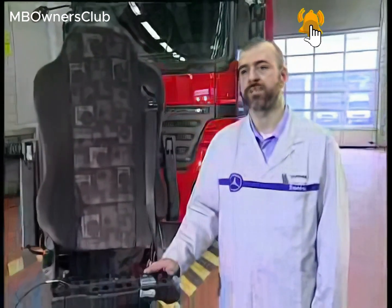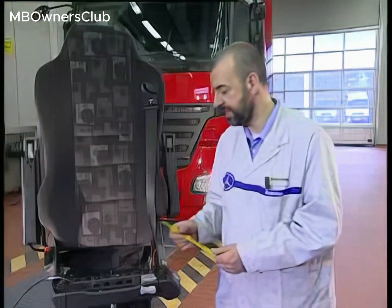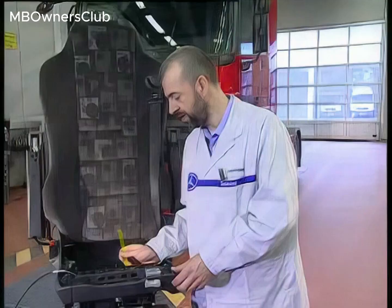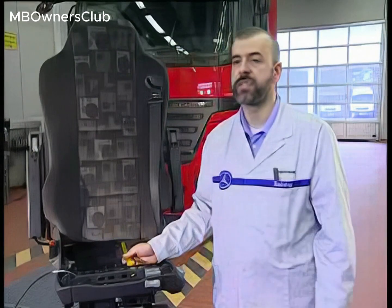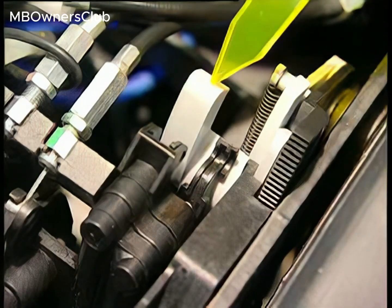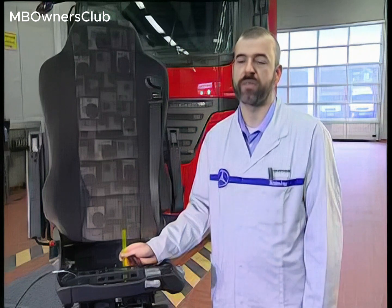Note the different adjustment values on this seat with black valve levers and grey cams. The distance on the express lowering cable between the Bowden cable retainer and nipple should be between 4 and 4.3 millimetres. The specified distance for the height adjustment Bowden cable is between 7.2 and 7.4 millimetres.